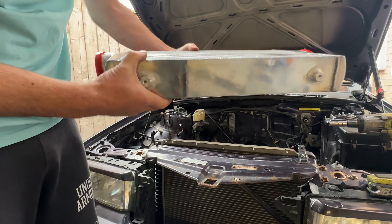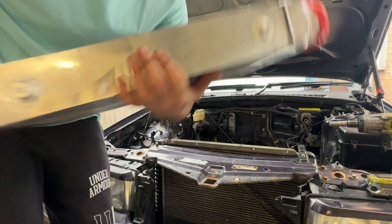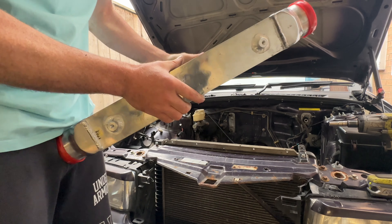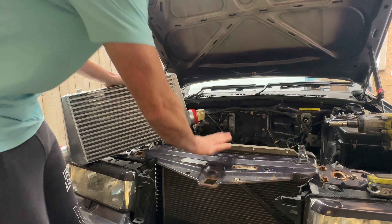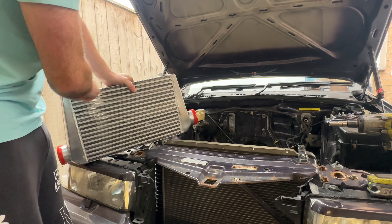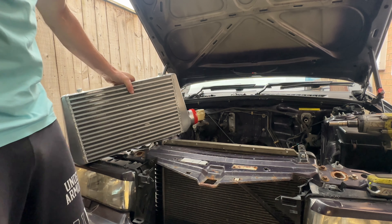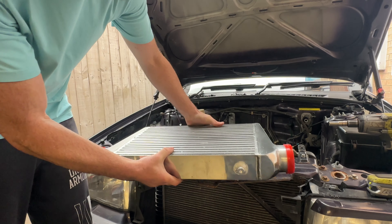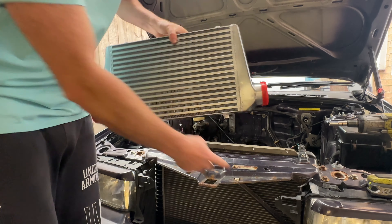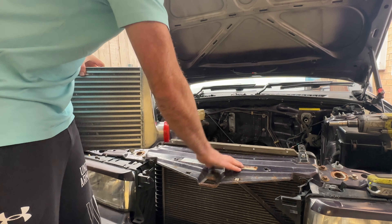The mounting of the intercooler is the next thing we'll look at. On the intercooler, on the top and the bottom, we have these welded on — just for the ease of being able to bolt it to whatever I see fit. If we're having the intercooler this way around, it'll be on the underside of this, so I'm going to drill into this and bolt the top of the intercooler to the underside. That's nice and sturdy — it's not going anywhere, which is perfect for mounting the intercooler. It'll also help having the intercooler as high up as possible to avoid the chassis rails. It'll be kind of floating at the bottom, so I'll see if we can make a brace to go across somewhere easy to bolt it, just to support it further — but this will very easily take all the weight.